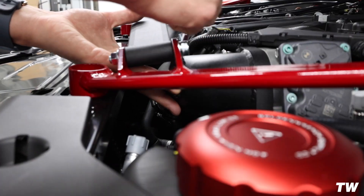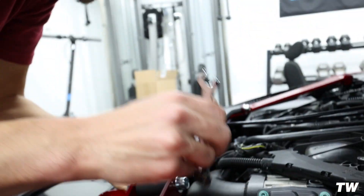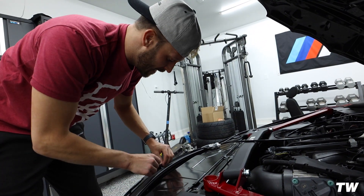I also ran the LED — that LED is there for when the meth kit is actually spraying. When I'm in boost and meth is spraying, that LED is going to light up and let me know. We got a couple more lines to run, and then we go ahead and put that boost tap in right there. Now we're using the bung in the charge pipe and we're going to put in the meth jet. We went with the middle jet — the only way to tell them apart is they're either more aggressive or less aggressive based on the fins on them.